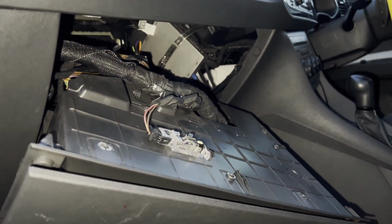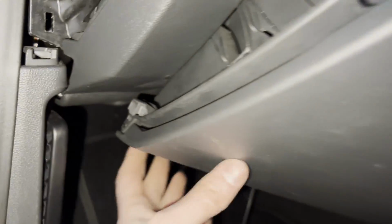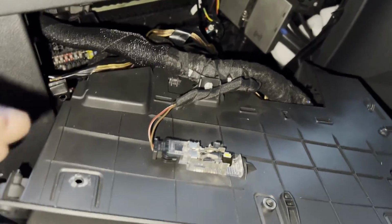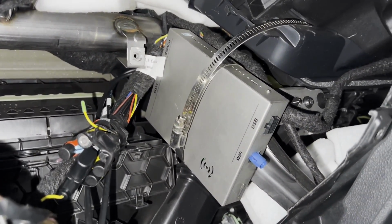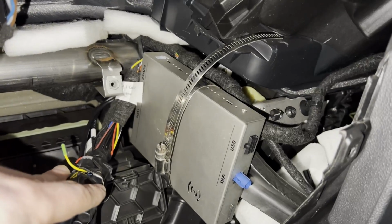So I've been trying for quite a while to get the box fitted up. What I did is I've sort of removed the glove box a bit more. Further to the screws that I removed previously, there are also 3 screws in the bottom. Go there, and just down there. So I've removed them, and then pulled the whole glove box out, which just pulls out either side, and I have used I think it's a 96mm to 140mm Jubilee clip to fasten it to the dashboard support. So that's what I've done.